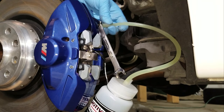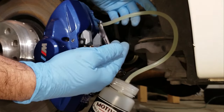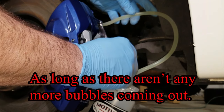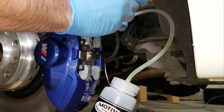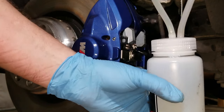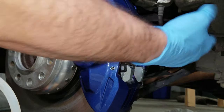I've always thought the brakes on this car sucked since I bought it, and with the amount of bubbles that just came out, I can totally understand why now. The color of the fluid has changed to the clearish yellow, so it should just be straight RBF 600 coming out now. I'm gonna tighten the bleeder valve back — just snug it up until it stops — pull the end of the line off the bleeder valve, secure the tubing back onto the top, run the brake wear sensor line back through the cap, put the cap back on, and we're ready to go to the next one.